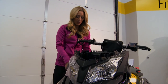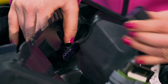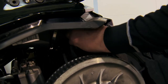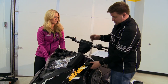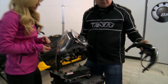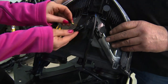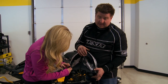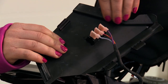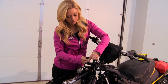As Fish finishes up with the glove box extension, we're going to get ready to disassemble the sled so we can add the auxiliary LED light. We have the hood unbolted. For the lighting, there's actually a quick plug-in — the headlight unplugged, that simple. One last thing is the air intake for the air box — there's a quick disconnect with a spin and a plug-in connection. Once unclipped, you can pull the hood right off. Now with the headlight off the air box, we're set to put our auxiliary light in. The light fits right on the bottom of the headlight assembly, just put the fasteners through — be careful not to over-tighten in plastic, and they are nylock so it'll be fine. The colored wires are color-coordinated to match the numbers on the switch, making it very easy to install. This is where plug-and-play comes into place — you put the existing wire into the auxiliary one, that easy.